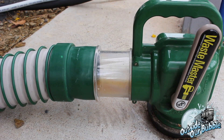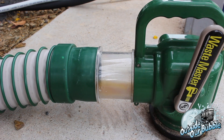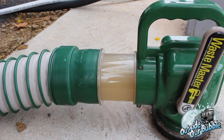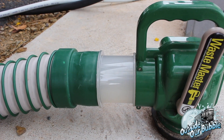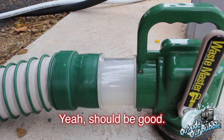Now with the black tank totally empty, as you can see there's hardly anything coming out. Now it's time for the gray tank. Opening up the gray tank, you'll see the black matter is pushed out of the tube, followed by the gray matter. Here comes your gray water, which looks really nice and clean, right? So I must be keeping my gray tanks totally clean and I shouldn't have a problem, right? Well, we're going to find out when we power wash it.